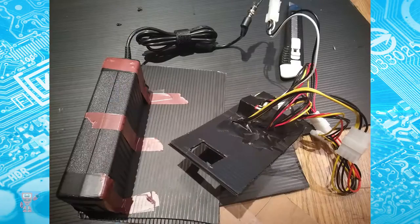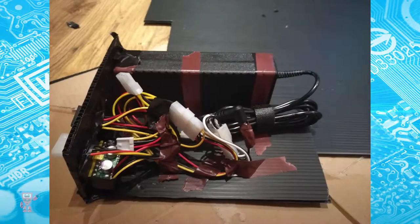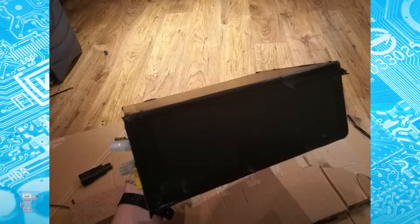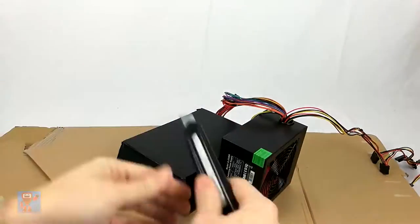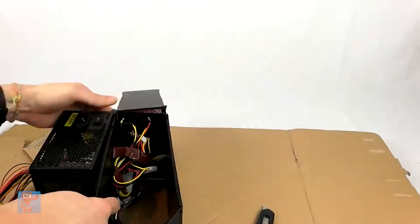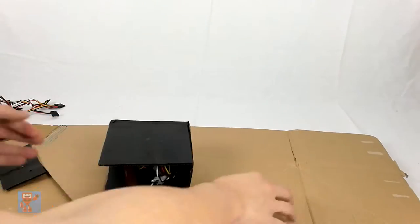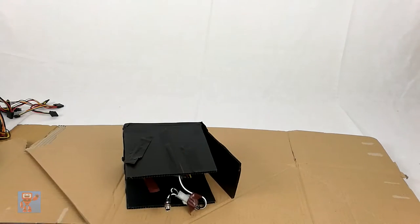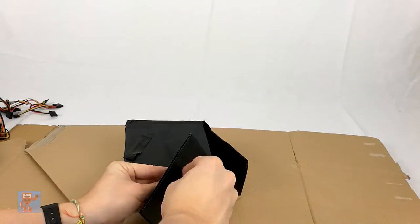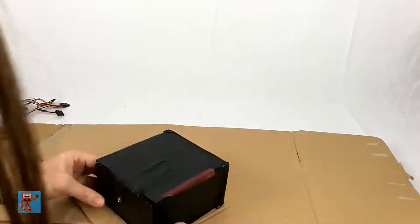Creating this power supply was a bit of a spur of the moment thing, so I don't have any videos of the initial work I did on it. I knew I was going to build this computer in a small case as a challenge to myself before I do a water-cooled build later in the year, and I wanted it to be extremely low power and very quiet. Using a Pico PSU, which just slots straight into your ATX connector, seemed like a good idea. It comes with a floppy connector, a Molex connector, and a 20-pin ATX connector. I also needed a P4 connector for the motherboard, so I got a converter for that. I then got a sheet of black corrugated plastic — the kind used for real estate signs — and started cutting with a Stanley knife. I roughly cut it to the same size as an ATX power supply, made holes in one end for all the connectors, and held them in place using electrical tape.